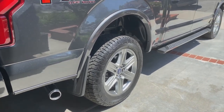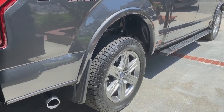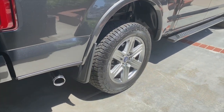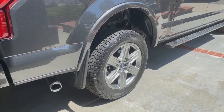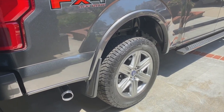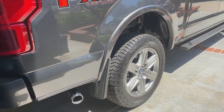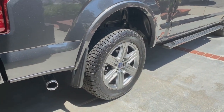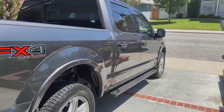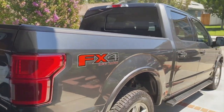The tire that came off the spare is a 275, just like these — the aspect ratio was different though. The other ones were 275/65R18 and these are 275/55R20. When you put them side by side, this is how Ford designed it — they are exactly the same height and the same width, except the wheel expands into the tire, giving a smaller aspect ratio and less rubber between the wheel and the road. I like it better without the raised white lettering — that's kind of seventies, kind of eighties. I'd prefer it without.